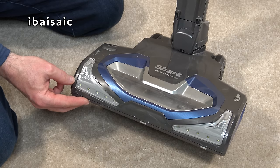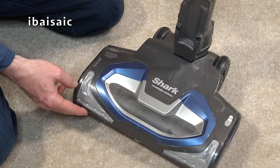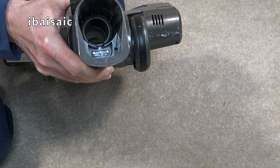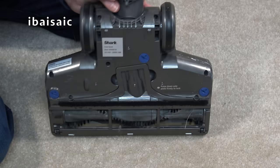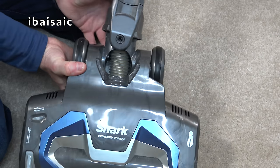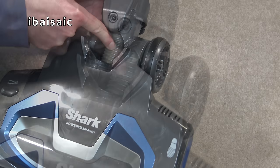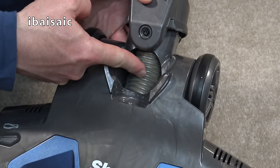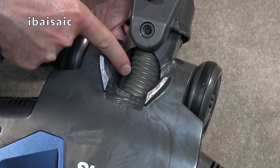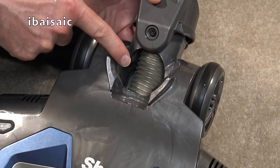The last thing I'm going to check is the cleaner head. When removed from the Shark it's easier to check for blockages and perform routine maintenance. You can do a visual check by looking down the air path here. One thing to point out: this internal hose can split — it's not just Shark machines, I've seen it on Vax machines, Hoover machines, and other brands. If that hose has split anywhere you will be losing performance and suction. If it splits within the guarantee period, I suggest you contact Shark who will hopefully issue a replacement.